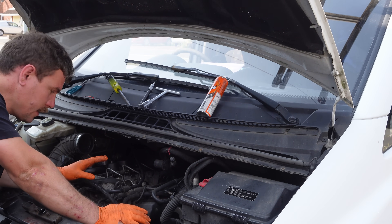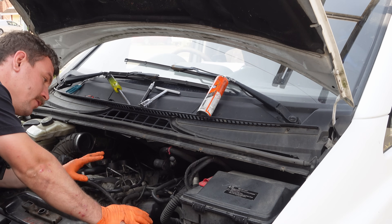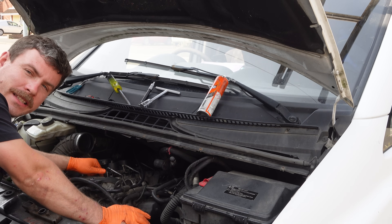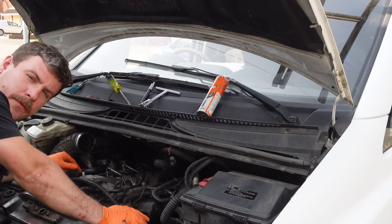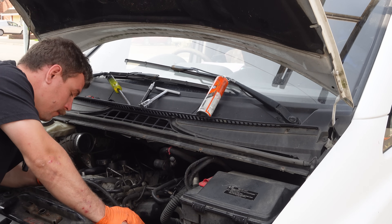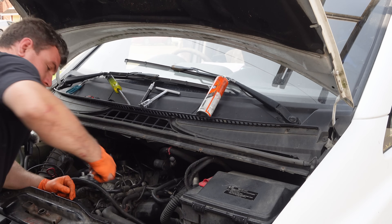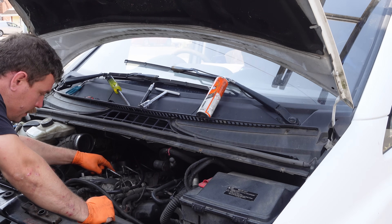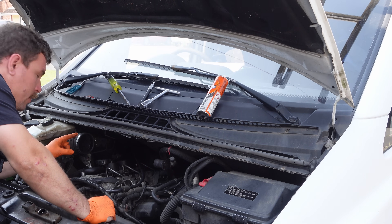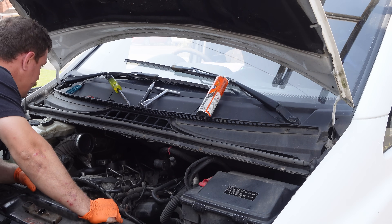Add a fresh bolt which we torque down to 7Nm and then turn a further 180 degrees. That torque figure of 7Nm and then the 90 and the 90 felt like it was going to snap off, but it was okay. That just highlights exactly why we need to clean up the threads on that bolt hole before we try and put that bolt in. Then it's the injector line, leak-off pipe, and power connector back on, ready for a test run. With everything together, let's make sure it starts, doesn't leak, and runs as it should. I had to put a socket on the crank to turn this thing over because when I was jetting down with the airline, the exhaust valve was open and I didn't want to be sending the material through the engine - I wanted it to come back up and out. Our breather is back on, power to the injector, injector line, run-back line back on. We need to connect the airbox, otherwise the MAF sensor will come up with an issue on the dash which I'll then have to reset.